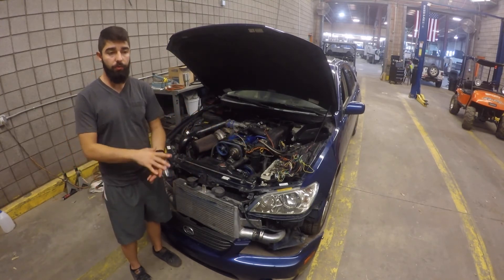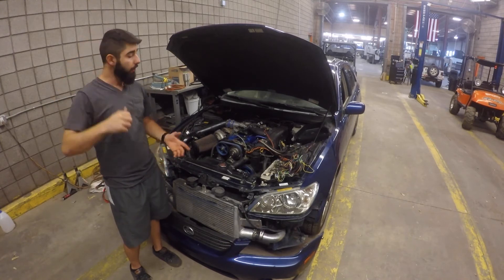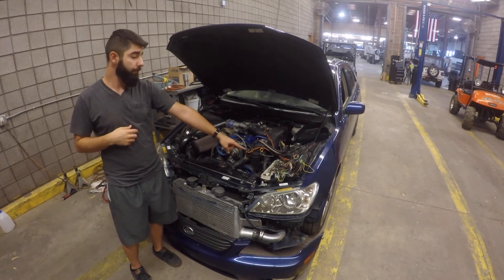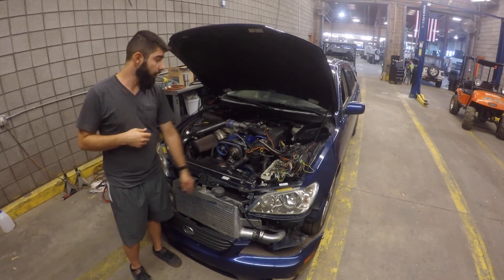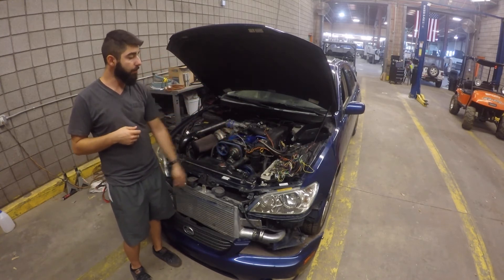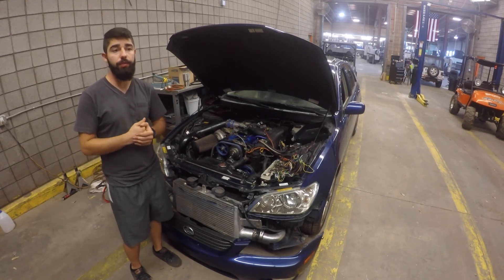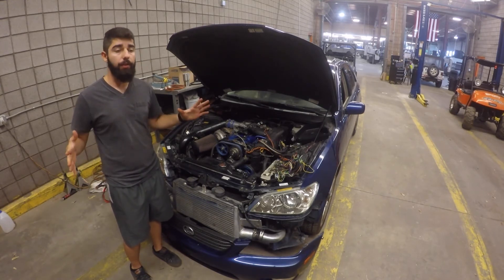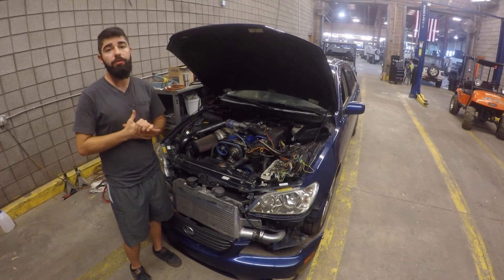The way the car is wired, it's on AEM Infinity and it's all custom — there's no wiring harness or anything. The crank sensor signals go from here to the stock ECU, which as you can see is all torn apart, and then from there goes to the AEM. So I thought maybe the stock ECU was interpreting that signal and doing something with it, sending it to the AEM wrong — so I snipped that wire, but to no avail.